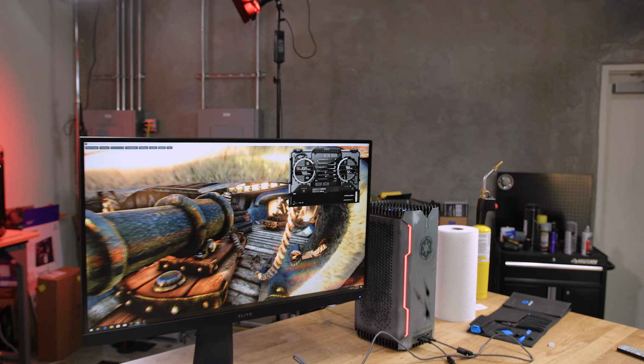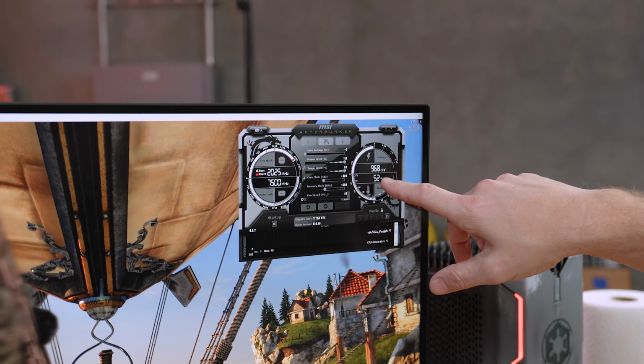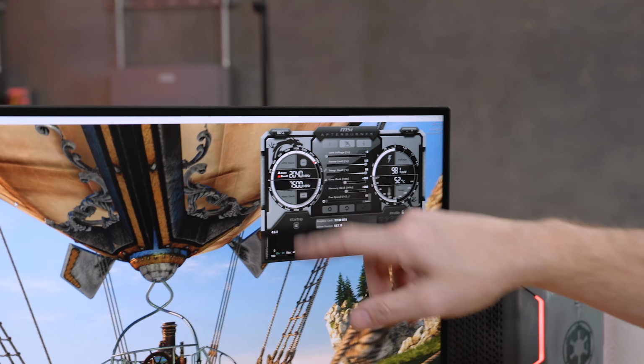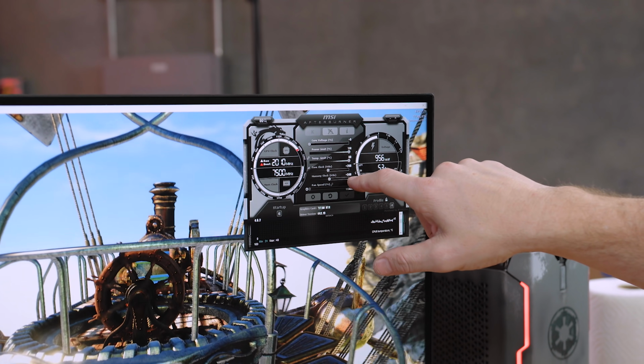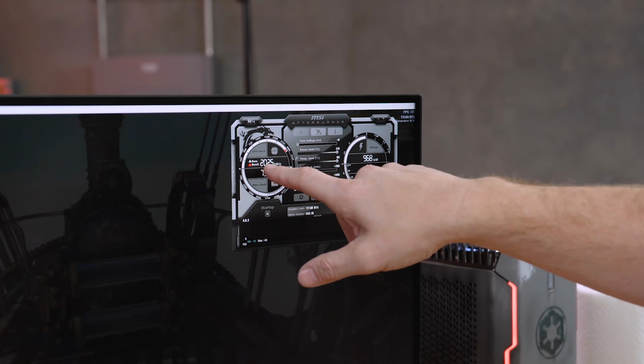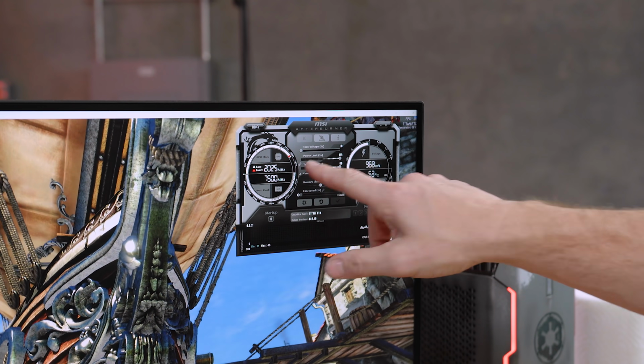Once the driver's installed, I'm gonna do a thermal check on this. I'm gonna run it under load for a bit, just to make sure that it's not doing anything like I got a bad paste or not enough paste or whatever. So we've had it running for a bit right now, and I was even playing around with some of the overclocks just because I wanted to see if this PSU was gonna be a problem. It maxed out at 54C. Right now it's dropped down to 52 because I reduced the clocks a little bit. It's got a 200 megahertz offset overclock plus a 500 megahertz on the memory. So it's running just over 2000 megahertz, I almost said RPM, 2000 megahertz on the core,